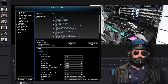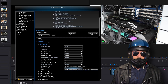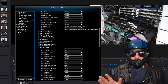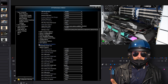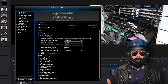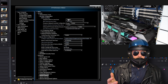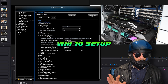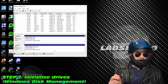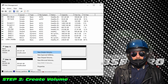You'll notice I've got quite a few lanes bifurcated due to all the different PCIe slot adapters I have equipped. While we're here, there are a few other BIOS settings of interest: things like fast boot — quite a handy setting — and performance settings. I'll also mention legacy support and secure boot, which could be really important settings to toggle. In my case I still have secure boot on, but if you want to install other operating systems you'll probably want to toggle those. Now for Windows setup: first thing is initializing the new discs — hopefully they come up for initialization; if not, they may have been used before.